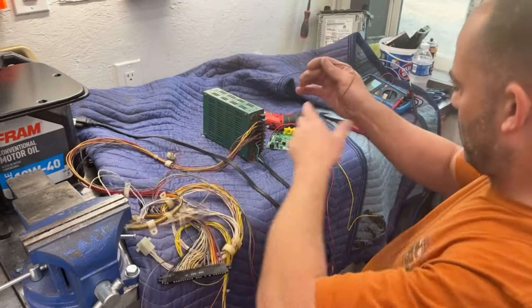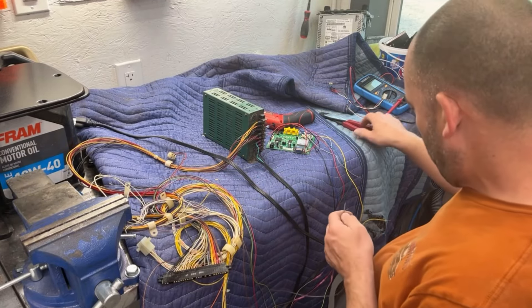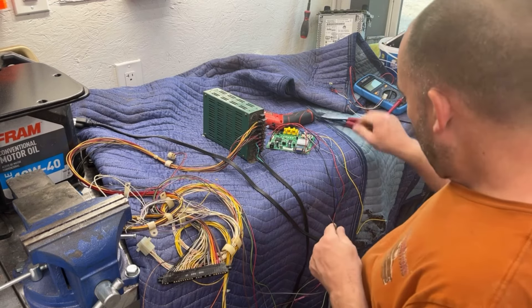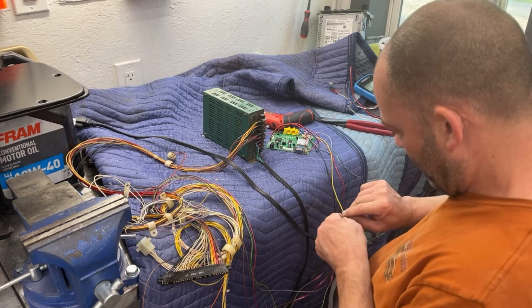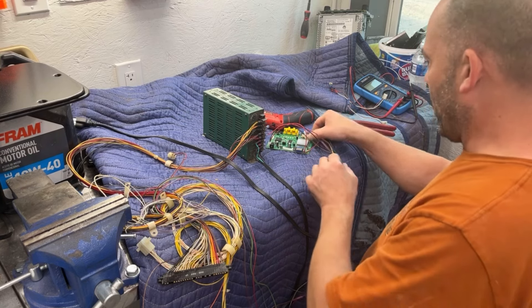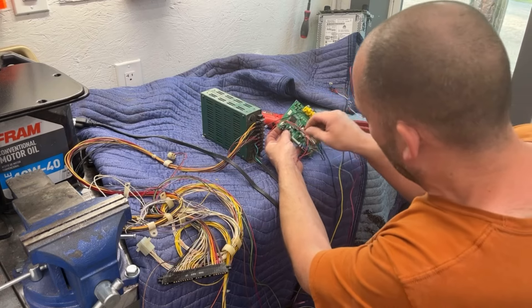I've used Fastenal quite a few times to ship games and I've had really good luck with them, but I've only shipped games that needed restoration — never one that was already restored — so I can't verify if it would get damaged in shipping. For the sync wire, let's just put it on the yellow for now and twist it together, and if that doesn't work we can switch it. This connector has a notch, so it can only be plugged in one direction.